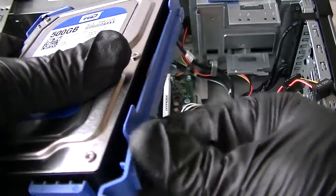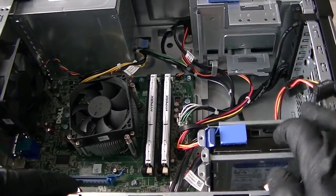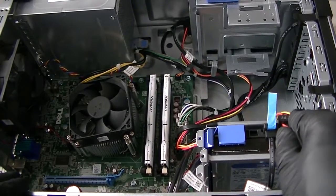It's really easy — this bends really quickly. The little plastic bracket comes off to install the hard drive caddy. I'm going to pull it back in and connect the SATA cable and the power cable for the hard drive.